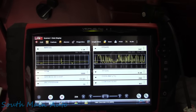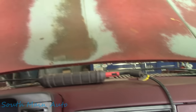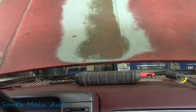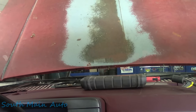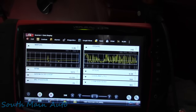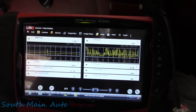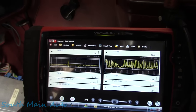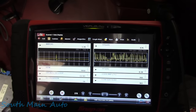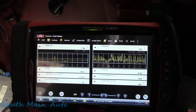I'm thinking what I'm gonna do is eat some brisket sandwich. Think about working again, because the other variable is, you know, the hood's up. So there could be something under the hood that's getting smoking hot. But I can't think of anything under the hood that was going to go wrong that would have affected so many different things, like the coolant temp sensor, the throttle position, the map sensor, the idle air control. Everything was acting really silly. The only thing I could think was just the engine ground, AC voltage by the alternator, which clearly wasn't the case. That's why I checked that initially.